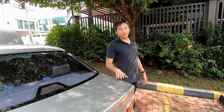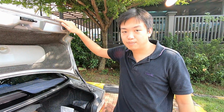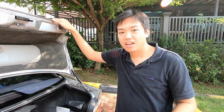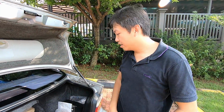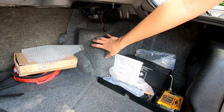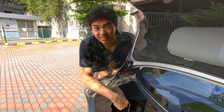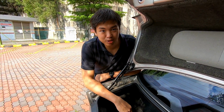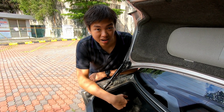On the E36 and E46, these chassis are prone to failure at the subframe and the strut tower, especially on the more powerful engines like the 325, 328 and M3. So if you are buying a used car, ask permission from the owner and take the trouble to remove the carpets and upholstery so that you can look at the condition of the strut tower at least. I never thought I would be so unlucky to have this problem on a 325i, so I skipped the trouble of checking before I bought the car.